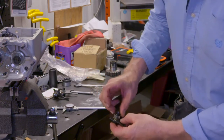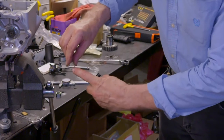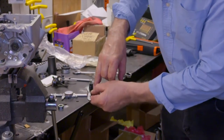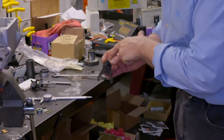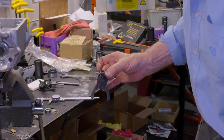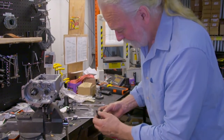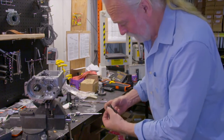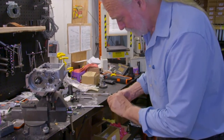So we'll first remove the lock nut, the lock tang itself. You see the tit at the bottom to locate in the slot in the finger roller sleeve itself. Now you'll notice, let's call the finger roller stud 12 o'clock. You've got a slightly offset kick toward the back. So you'd want to watch for that because you can easily turn this around and install it the wrong way. Now it's kicking forward. It's not going to go into the box proper. So let's put it back where we were. And I'll give you an idea what to look for here.